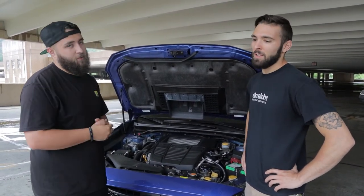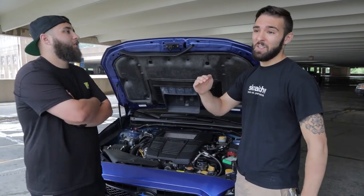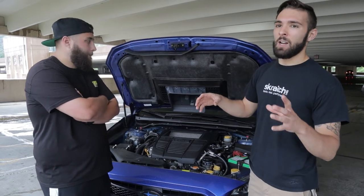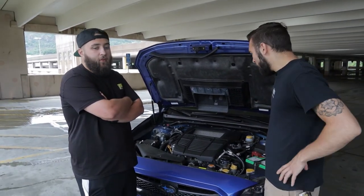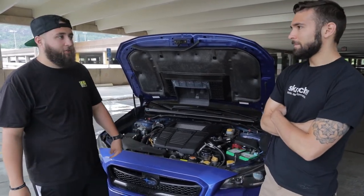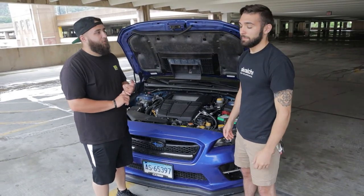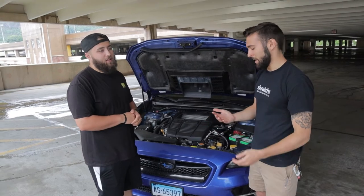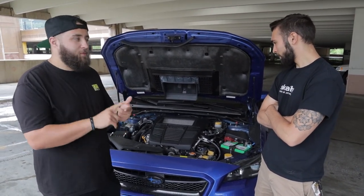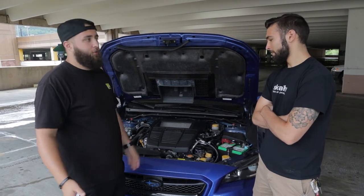Oil weight: run 5W-30 unless you're in a place like Florida or Arizona where the lowest temperature you'll see is 65°F year-round - then you can run 5W-40. Make sure everything you buy is name brand: GrimSpeed, Cobb, Perrin, Mishimoto. Don't go on eBay for performance parts. Appearance parts from Amazon are fine - carbon fiber lips will get destroyed anyway. For performance: name brand only. IAG is the go-to for built blocks and next-level engine work.